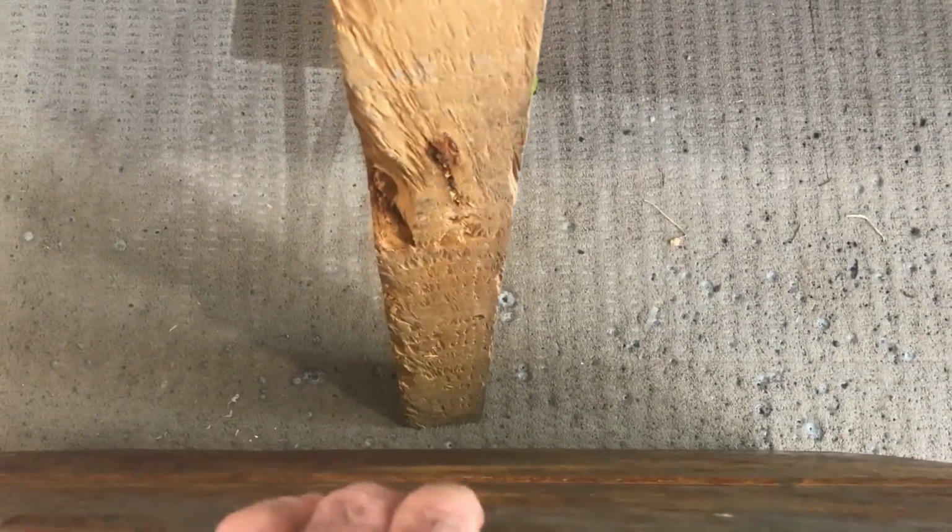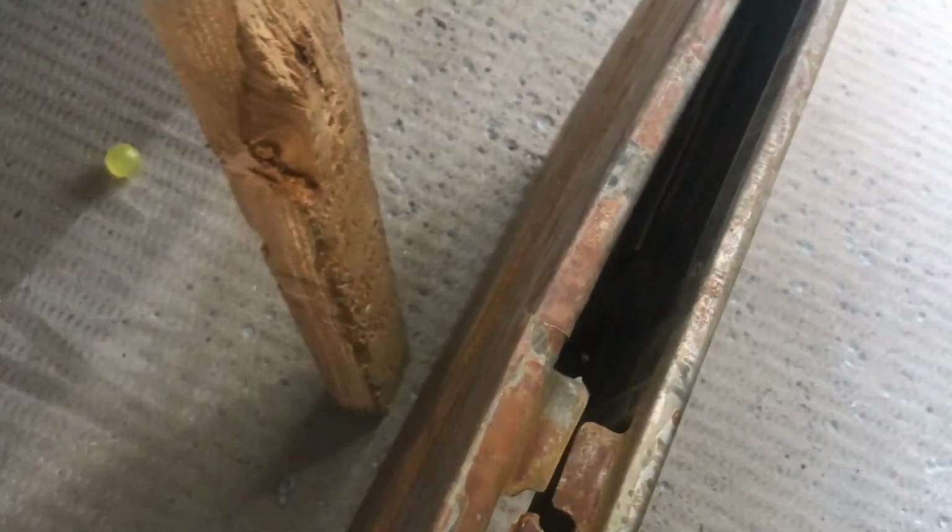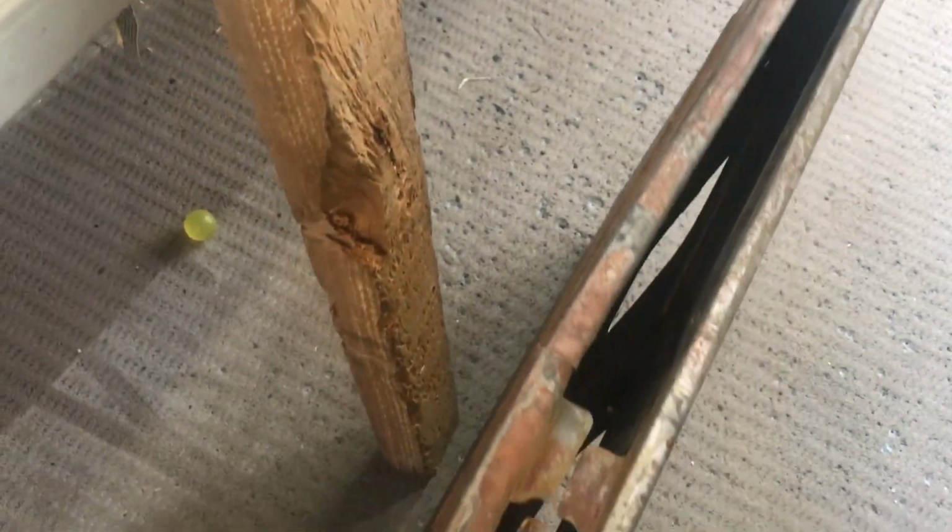And I'm not going to know until I get the door back together and on the hinges. It'll be all painted then. I can't stiffen it up then, so I'm going to do it now. The other door was the same, so it's obviously a bit of a weakness with them. I'll take that bend out of it, and the fact that it just wobbles around so much. I think putting that angle in will stiffen it right up.